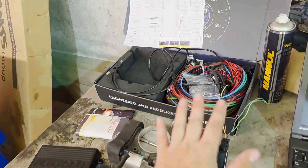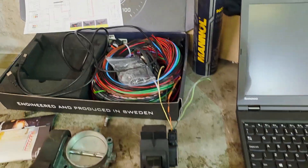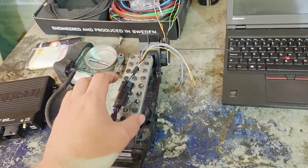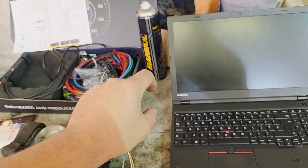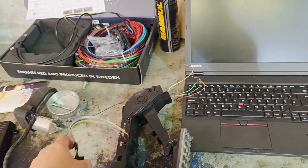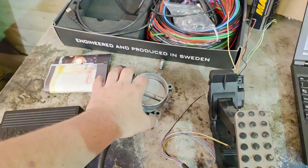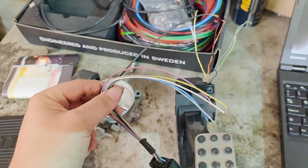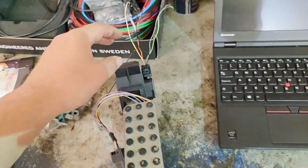Then I've got to learn my way around the Max ECU and tune it. I've done a quick bit of research and found a service manual for the Crossfire. That manual had all the connectors, the shape of them, where the pins were, what they do, and what colors they should be. And would you believe it — for this CLK throttle body and this Crossfire pedal, all the colors and pins were dead right.